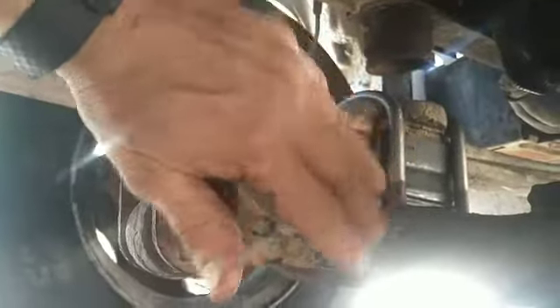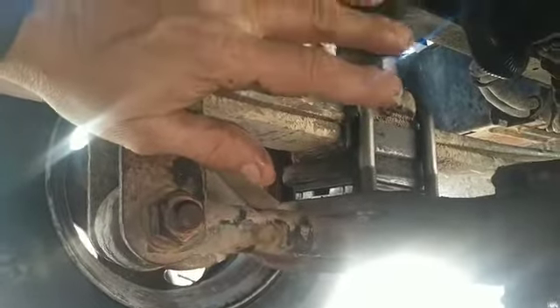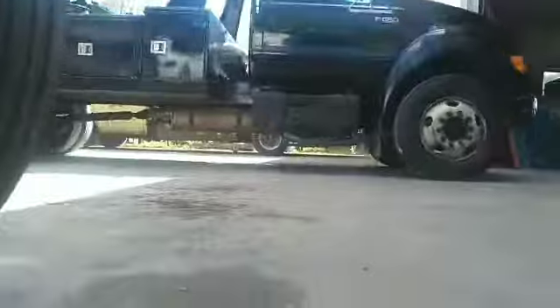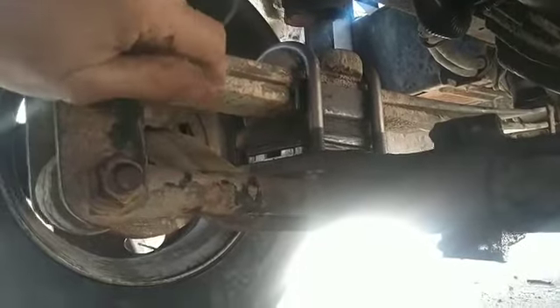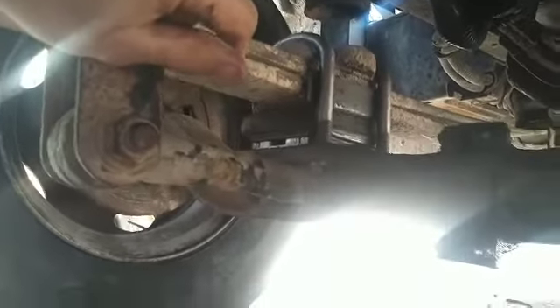Check every bolt. Stop and think about it, do some testing. But in this particular case, I needed to go negative on the caster — negative on the caster — to make this work.